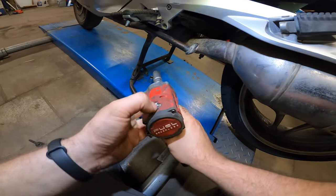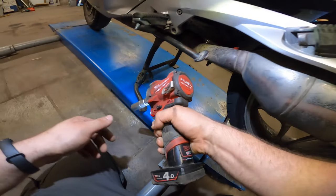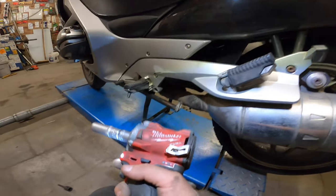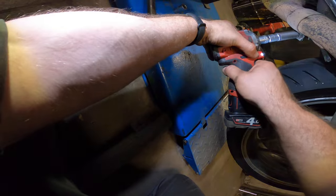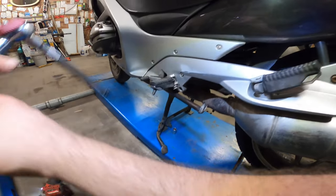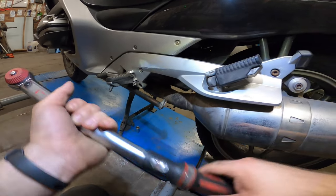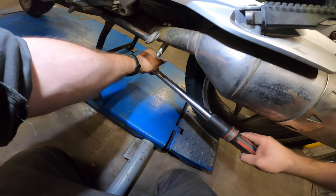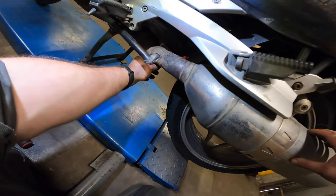You'll start by number 1 with number 1. Typically. Sometimes it fails. I have to fix it. Reset. When we bottom out the number 1 setting, it will be around 60 newton meters. And of course we could use our torque wrench. Just feel for it, you'll feel it. Yeah, that will be around 20, 25 perhaps. You'll need to check it out.